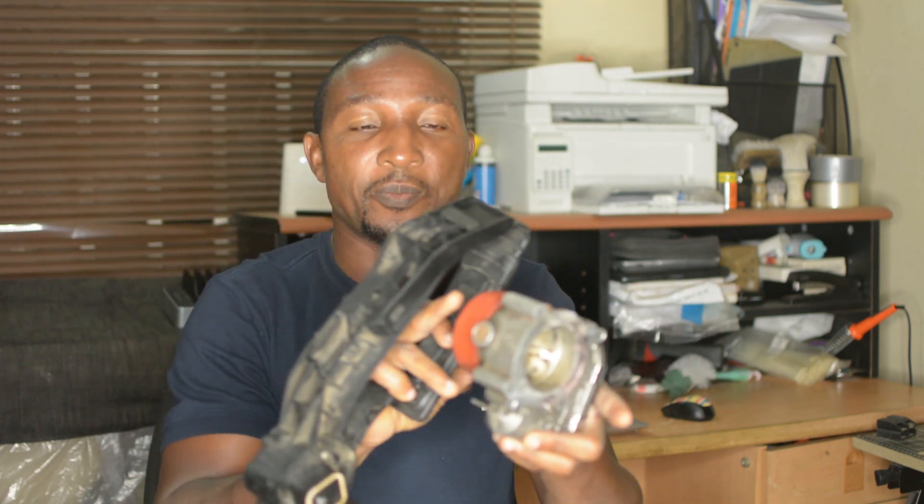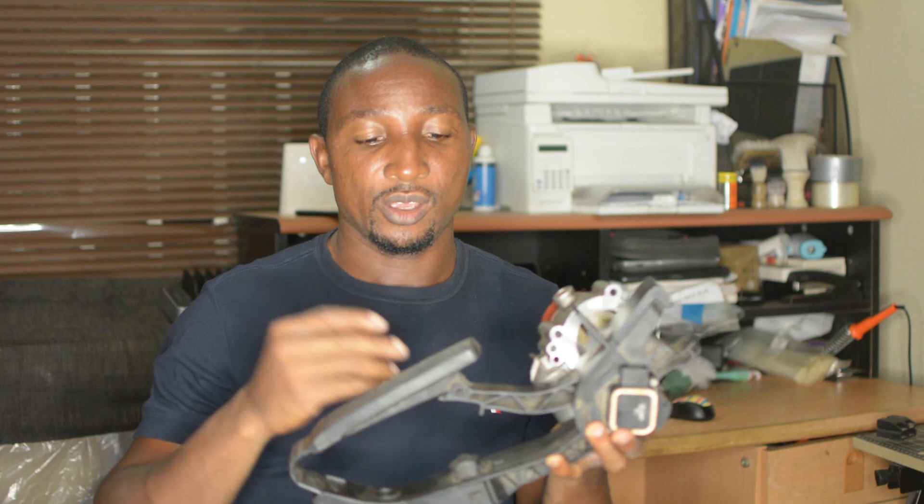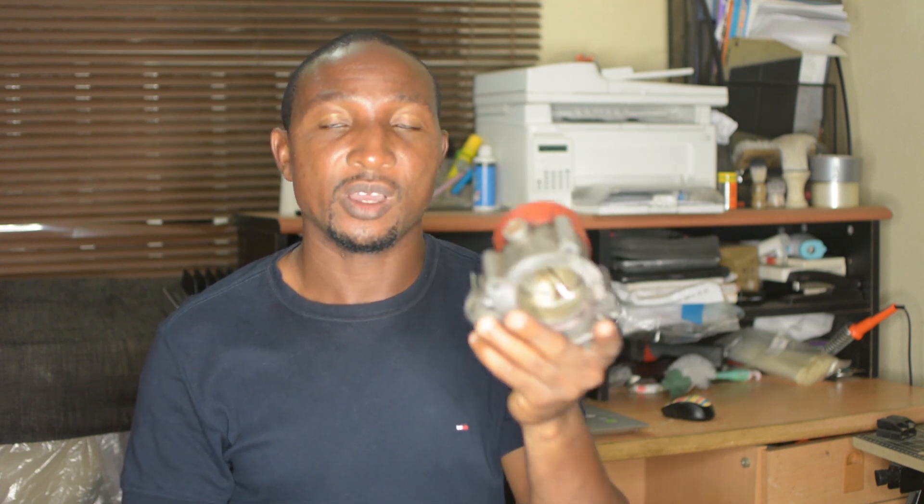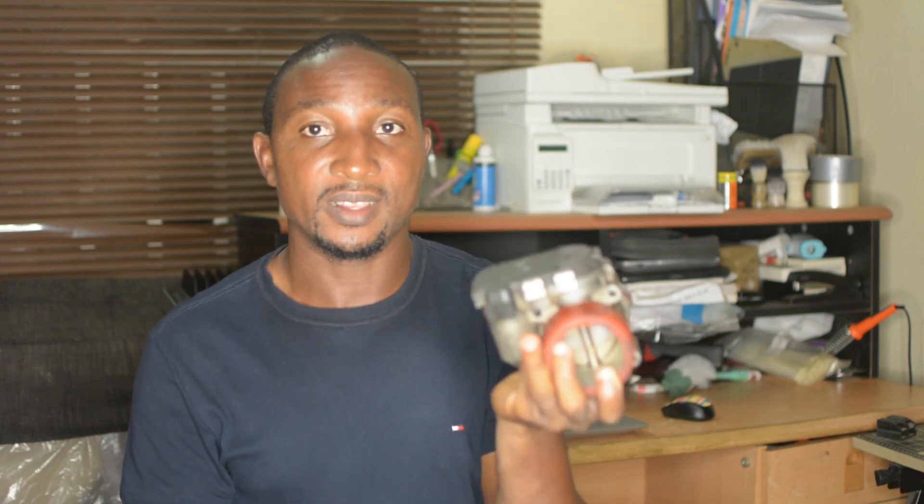With it closed, just a little bit of air can pass through — there'll be a 3-second delay to move, so the car will be moving very slowly. But each time you pedal and this thing is wide open, your car moves very fast. The way this thing opens and closes is what determines the speed of the car. This is the throttle body — this is what actually helps your engine to run faster in the C230 Compressor 2003 model.